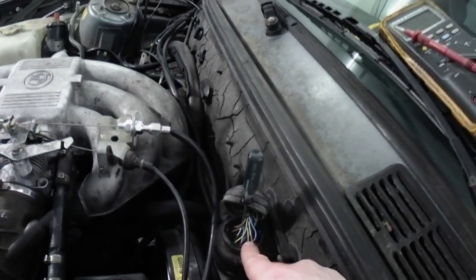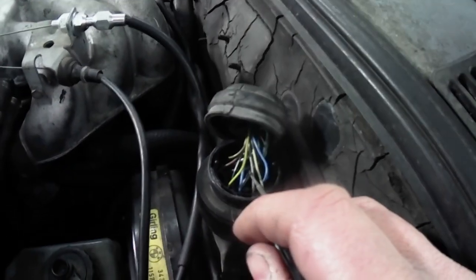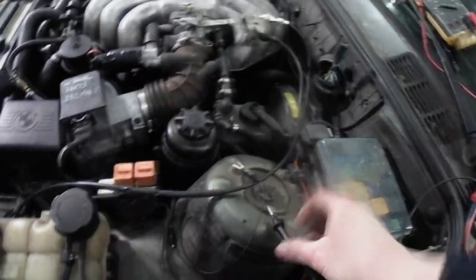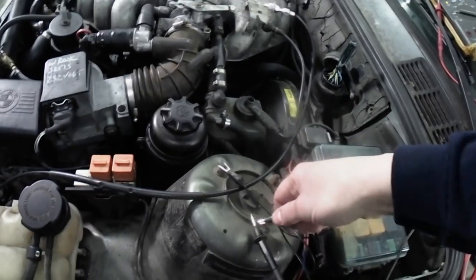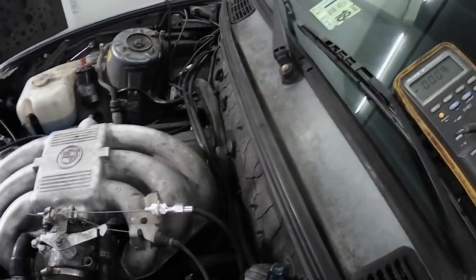So again, we've mentioned the relay is this one. You could try replacing that. The fuel pump also feeds through this connector, okay? It's pin 13, which is this one right here. Okay, again, we can do the same thing. We can probe that one, and we can hook up our meter. So we have ground there. I'm going to clip lead. Now, being that this is 12 volts, this is power, you don't want this to ground out to anything. So be careful that you don't ground it out. We don't need a hard short of any sort.